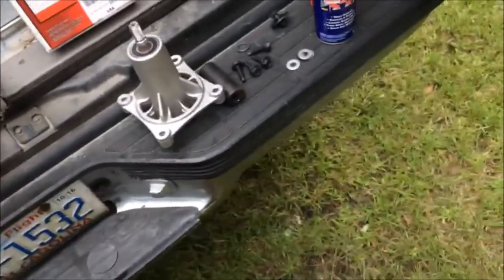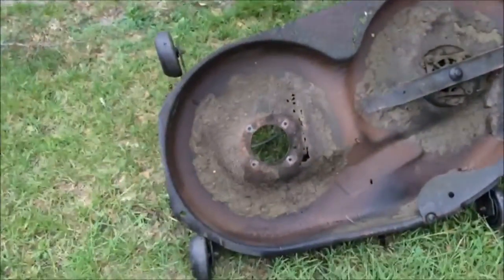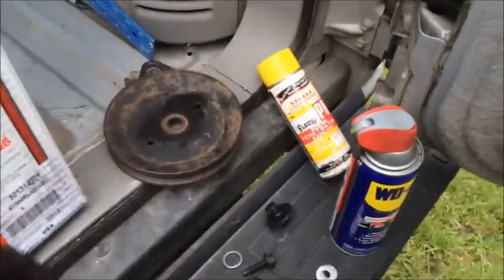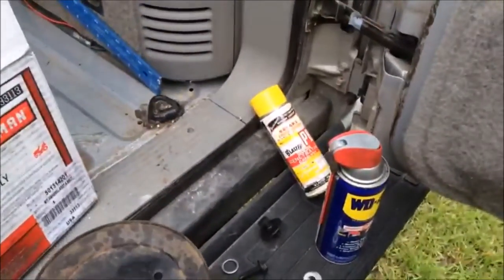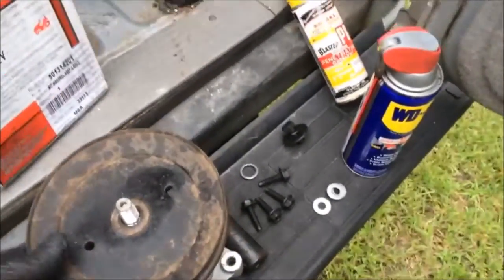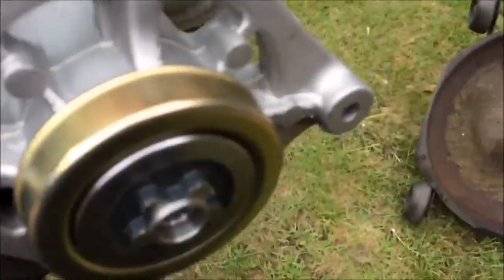So I pulled that one out. It's a fairly simple procedure. Here's the lawnmower deck over here. You take this large nut that sits on top of it in the deck, take the large nut off, pull the pulley off, and then this piece just drops right out of the bottom of the deck, so you have to remove it. And so,